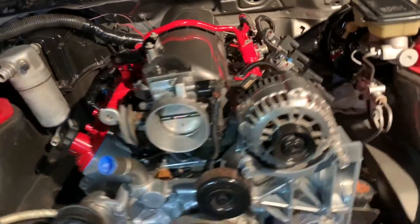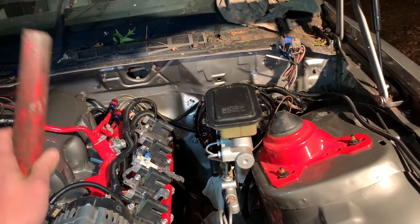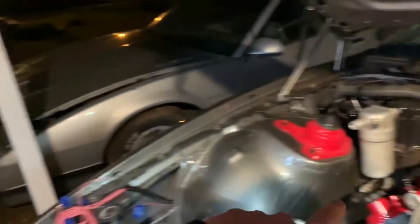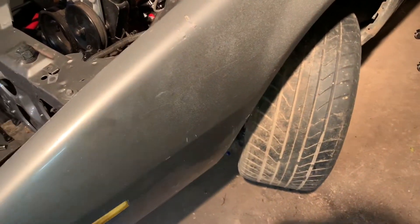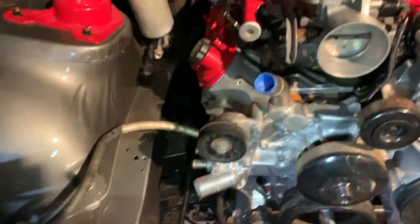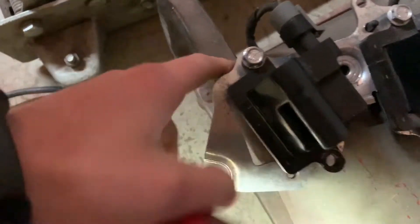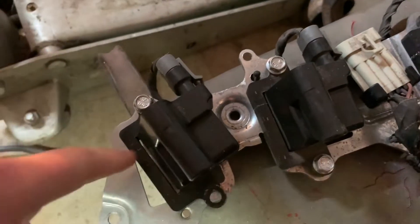I've done this part of the video a few times — kept recording in portrait mode. The windshield wiper motor would not fit, so I need to figure out the best approach there — might use the one out of this car or go another route. Also got a problem with the pitman arm hitting the AC bracket, so I need to trim some of that out. The wheels are turned pretty far to the left right now and hitting it — I need to remove the bracket and see how much further they actually turn before notching into it.